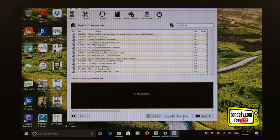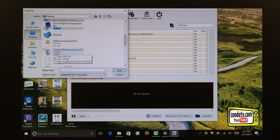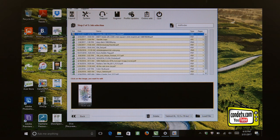What we want to do is select our designated size before we load the file into the RIP. Now that we have the size changed to 12 and a half inch by 19 inch, we can go ahead and click on Load File. I'm going to look on my desktop, which is hopefully where I have saved this file — and there it is, my Condé 25th Anniversary 12 by 19. Let me open it, and now the RIP will begin loading the file in. Once this file is loaded, by selecting Tabloid XL, we are defaulting the Forever Transfer RIP to print to a 12 and a half inch by 19 inch sheet to run through the Oki C920WT. Remember, the eight and a half inch by 17 inch sheet is to maximize output on an Oki C711WT, and the 12 and a half inch by 19 inch sheet is to maximize output on the C920WT.